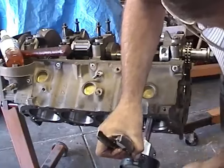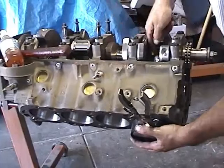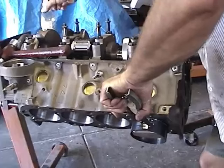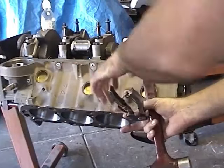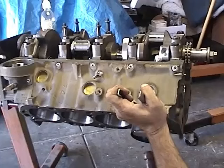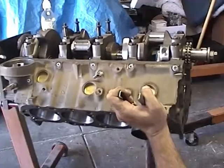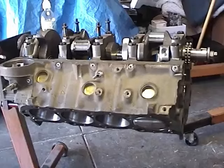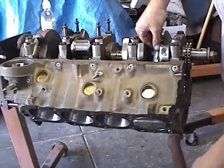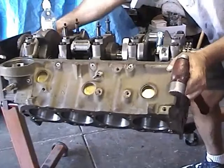I'm going to go ahead and start it in the cylinder. Remember, you never want to force anything when you're doing this — everything should fit nicely. Look up, check your rod, make sure it's going to go past your crankshaft. I'm going to take a rubber-handled mallet to tap this in. If it seems like the piston stops or is jamming up, just stop right there, take it back out, and inspect everything — you don't want to damage your piston or piston rings. Just tap it in nice and slowly, little taps at a time. It went right in, no problem. I'm going to hold onto this rod end and slowly guide it while it goes around the crankshaft journal.